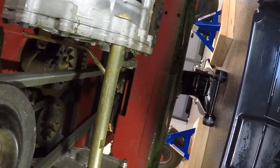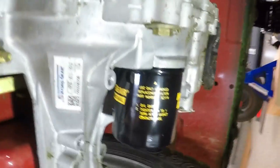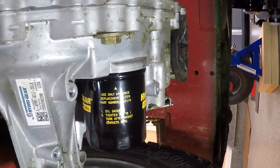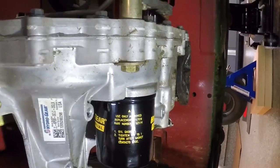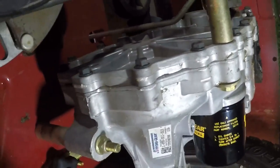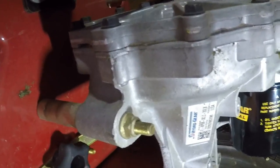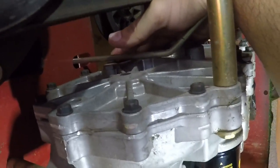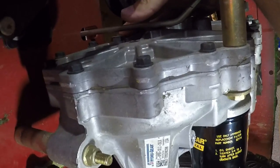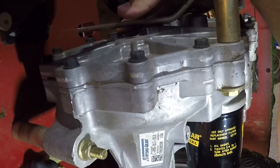I've got the new oil filters on — they just spin on like any other oil filter. Make sure that mating surface is nice and clean. As stated on the filter itself, once the gasket makes contact with the housing, you want to do three quarters to one full turn of the filter. Don't go crazy and tighten it too much, otherwise you could deform the gasket and cause leaking. Now, these are the top port plugs — we're going to crack those loose so that as we're filling the transmission, the air has a place to escape rather than having to work its way out through the hoses and the reservoir at the top. It'll fill a little smoother.